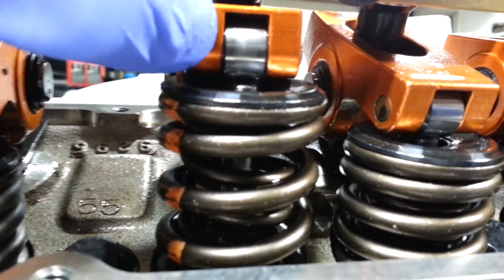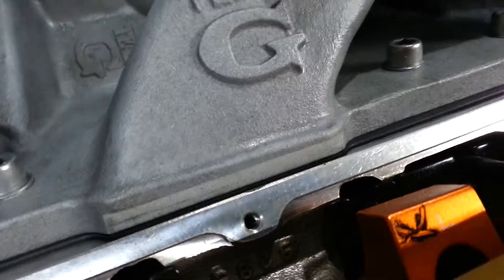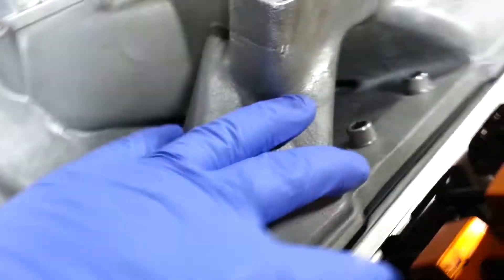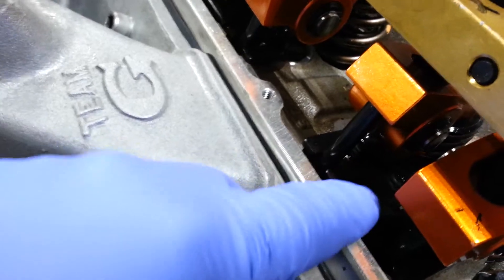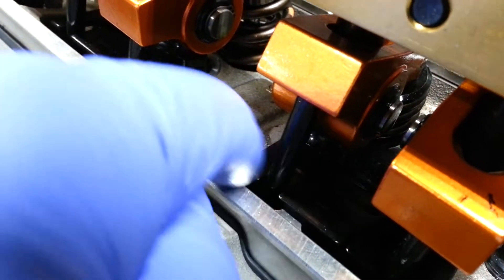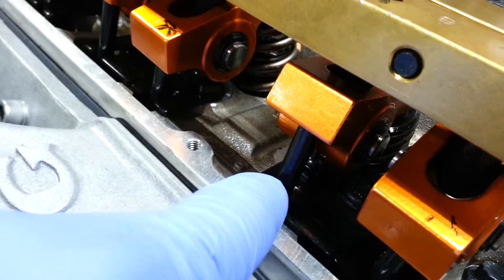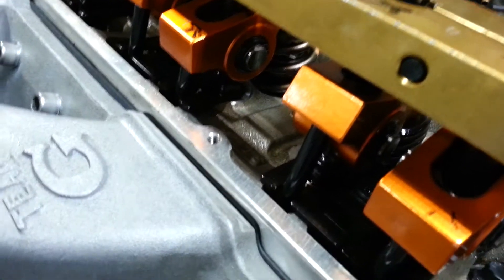When it starts to move, if it goes a little bit this way or that way it's still going to be pretty square. What I'm really referring to is just the guide plates with the push rods. When you set these up, these AFRs have little puzzle-piece type pieces that lock together — you just have the rod touching one side or the other for clearance, so you can push it in and out and move it around over the stud before you torque them down.